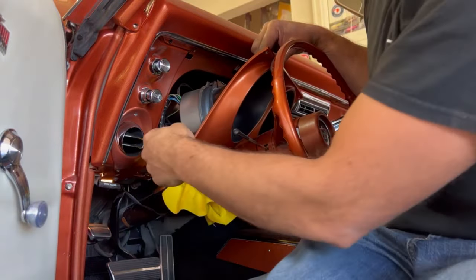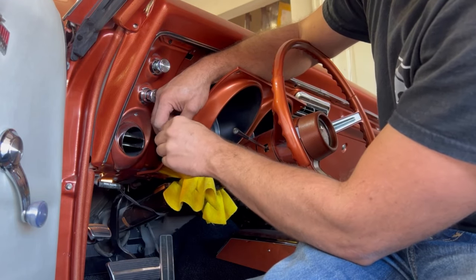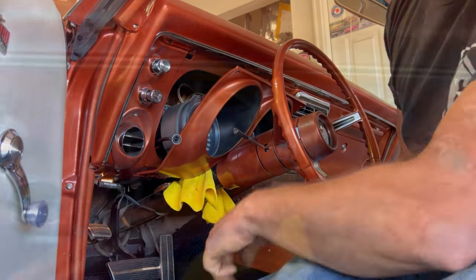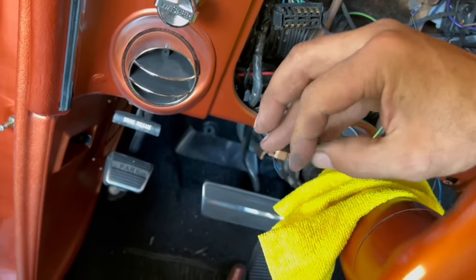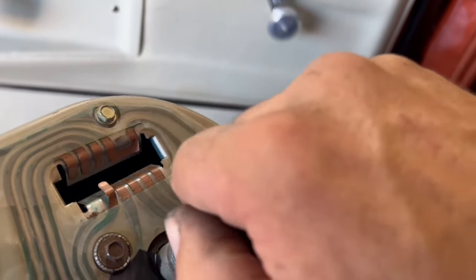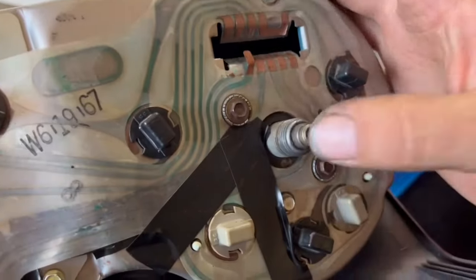Back here on the backside, I'm going to do the speedometer cable now from the speedo head. Now that cable spins really easily. I think we need to pull this back out and take a look at the backside of the inside of the speedometer, unfortunately. Got the cluster back out — I gave the speedometer cable here a little twist and a whirl, and I can pull this thing. It's smooth, nice, easy, moving. I don't think our problem is there. When we grab the speedometer drive on the back of our cluster and try to turn it, it's actually relatively snug and tight. I actually have the original cluster that came out of this car — because this car wasn't originally equipped with rally gauges — so I can go grab it and compare the drag.